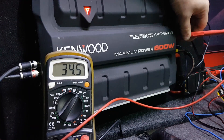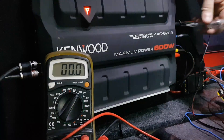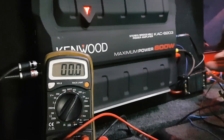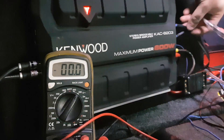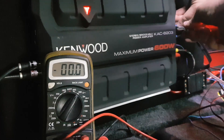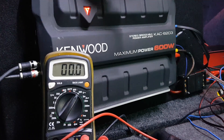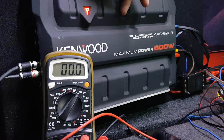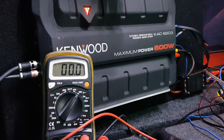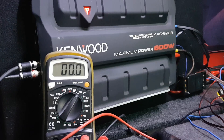Now just turn your head unit back down. And that's done — that's how you set up the amp. Remember, don't go by peak power; you want to go by the RMS wattage in your manual. If you're bridging it for your subwoofer — in this case it's 300W at 4 ohms — that's what you tune it for. Look on the chart and it tells you what voltage to set it at, just like I've done here. Thanks for watching, see you soon.